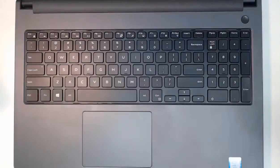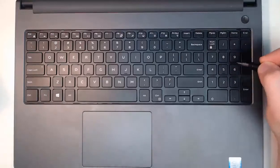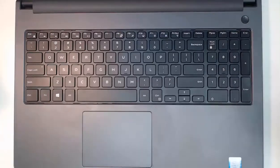So with that first laptop pretty much done except for the connector, let's take a look at the second laptop, as well as the same connector there that we would have seen on the first laptop. On the second laptop, there are no screws to remove on the bottom of the laptop. And also, there's no locking tab. Instead, we're just going to have our slots where we need to press to disengage the locks for the keyboard. So we'll zoom in on those, and I'll be able to show you how to do it.